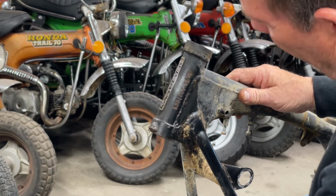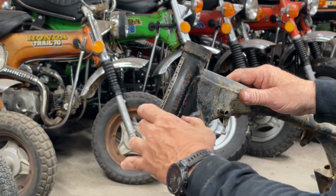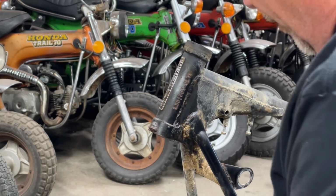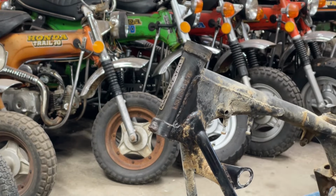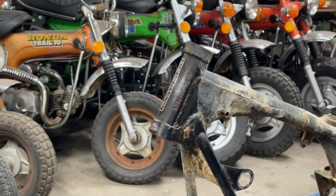So I've got to cut this off, re-weld a little longer piece on there so I've got a good steering stop. I'll clean all the grease off of these, get them all good and cleaned up, clean the rest of the frame up, and get it spray painted. Then the next video will probably be cleaning up and working on some of the parts, and then there'll be a third video where we assemble it all back together.